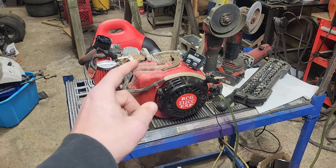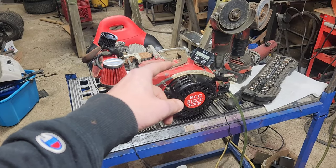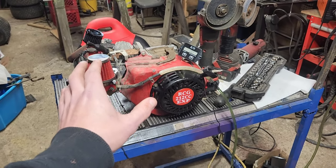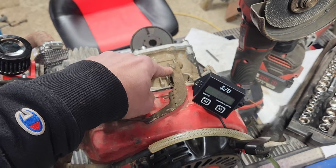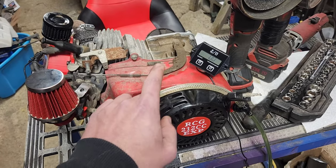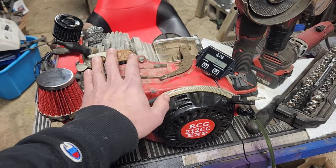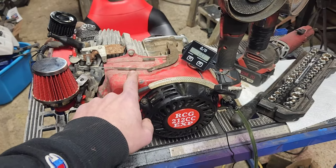What if the only reason the 'monkey see, monkey do' method of how we remove governors was so that you had to buy stuff from a sponsor? A lot of old timers have blown up my inbox, emails, and comments with the idea that you do not have to cut this, and their claim is that the only reason those get cut off is so you have to buy all that top plate junk that YouTubers do for sponsorships.